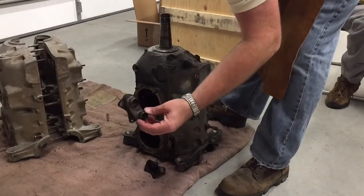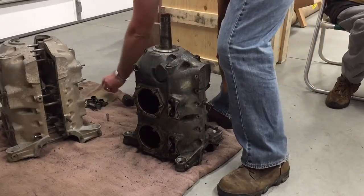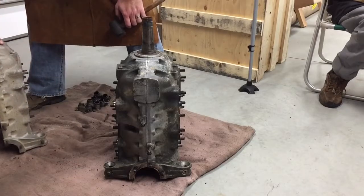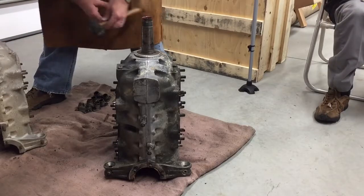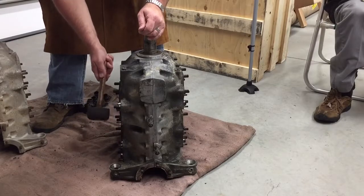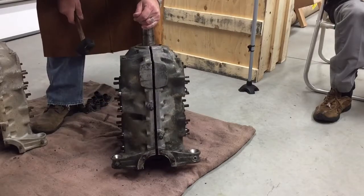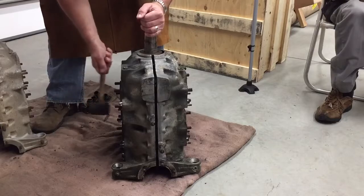You don't have to take these off, but I went ahead and removed them and laid them over here. We'll turn the crankcase — I brought this one into the shop so I can look at it and tell what's what. We'll just tap lightly on these two studs right here, tap on one and then hit the other. As you can see, we're already a good full quarter inch apart and it's splitting pretty evenly all the way around, so we'll just keep lightly tapping.